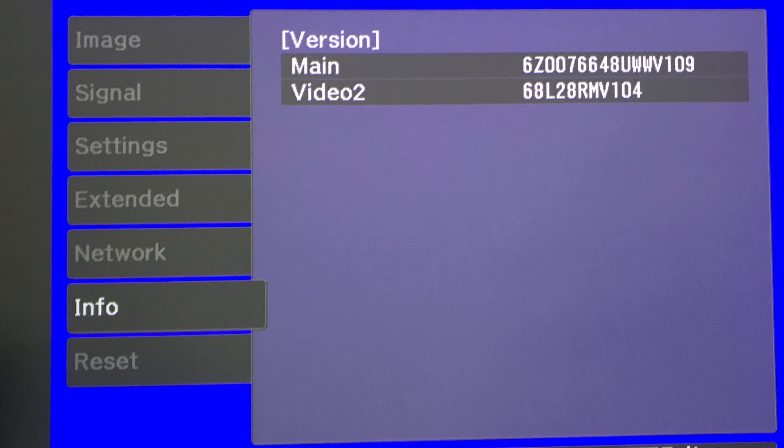It's that simple — the whole process won't even take you 10 minutes. Basically it relates to HDR. We've had a lot of trouble with projectors getting the best out of HDR, and Epson offers four HDR modes: one, two, three, four. Number two is the official standard — it's called HDR10 in the real world. Most people find that a bit too dark, so HDR1 is the one preferred by most people. The problem was that with HDR1 you couldn't use the auto feature, so as you're switching back and forth from HDR 4K content to regular 1080 SDR standard dynamic range, you'd have to go back into the menus to switch them.